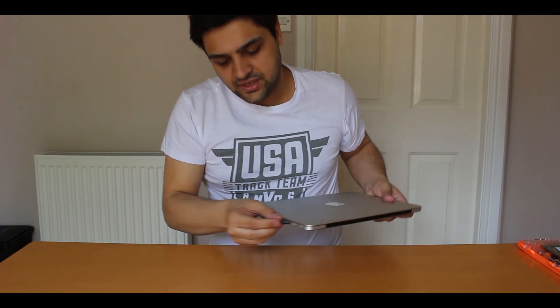The other option was to get one of these — it's an SD card, a Transcend JetDrive Lite, the 128GB model. It's essentially a 128GB SD card with a specific form factor for the 13-inch Retina MacBook Pro, so when you put it in it's completely flush to the MacBook. That was pretty good for a while and offered extra storage for music, movies and documents, but I was also running VMs and I couldn't get the throughput on an SD card that you can with an internal hard drive.